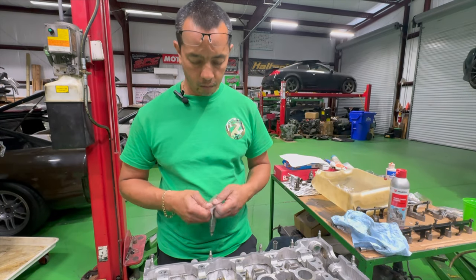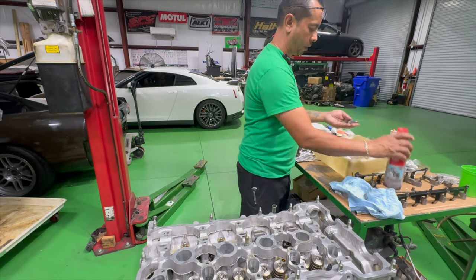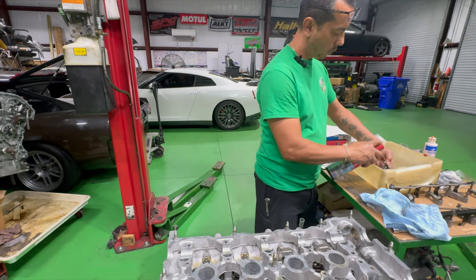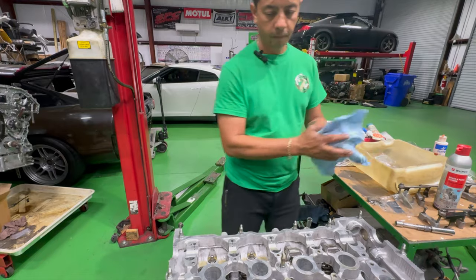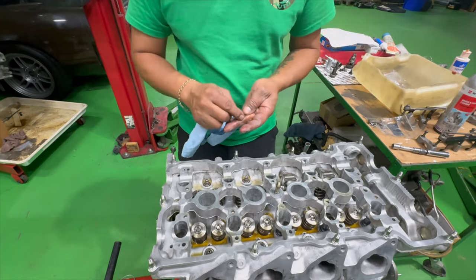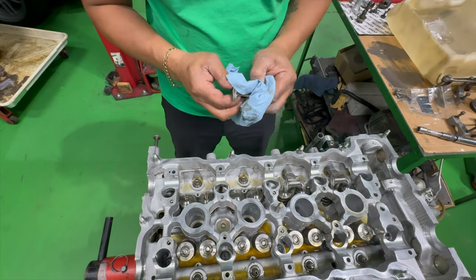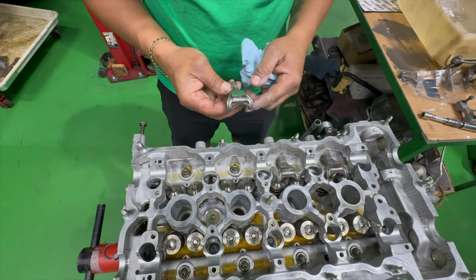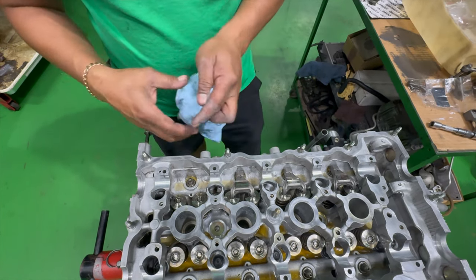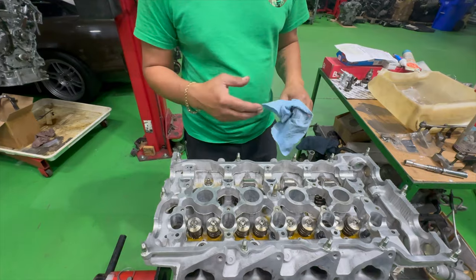So final cleaning before I put the shims and the rocker arms in. I just always keep them in bags separately when we shim them out to make sure that we have them back in the right position. So on final assembly, it's faster that way, and we're not running a feeler gauge back through them. And also, it's not primed and pumped up, the lifters, so you can get a false reading. So before we take them apart, we actually do that and take our measurements.